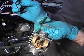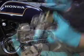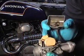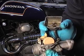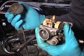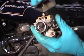There's the body of the carburetor without the gasket. Okay, that tang's got to move. I've set the level, and I'm not sure that I can show you anything on the video that makes any sense, but it's much lower. It's touching about there now. So this will make a huge difference. Whether it's too much of a difference, we'll find out.